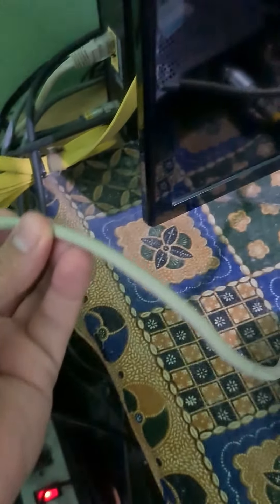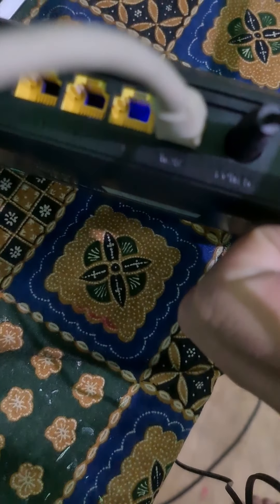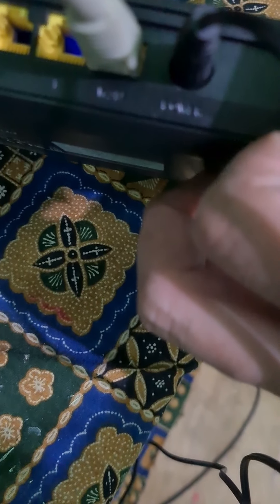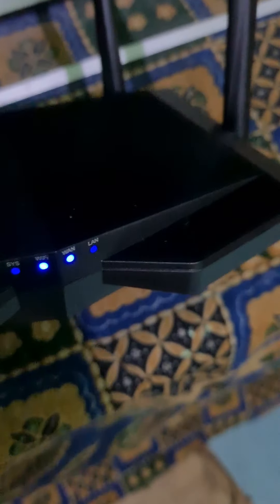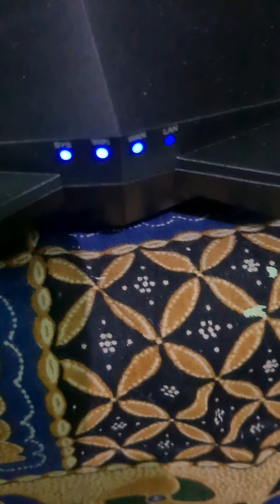Back for the installation. This is our modem router from my ISP. Take the Ethernet cable and connect one end to the modem, then plug the other end into the WAN port on the Tenda — it's labeled as port one. Ports two and three are the LAN ports for wired computers. Then just plug in the power cable. The indication that you already have a connection coming from your modem to your router is this Wi-Fi light — there you go.